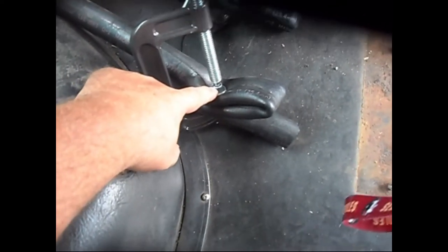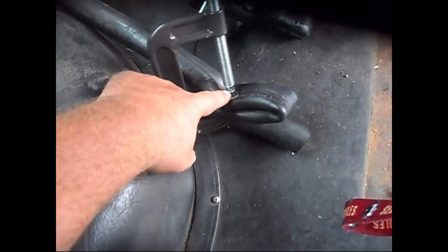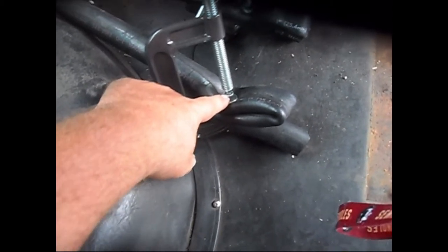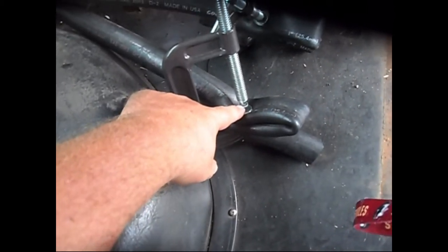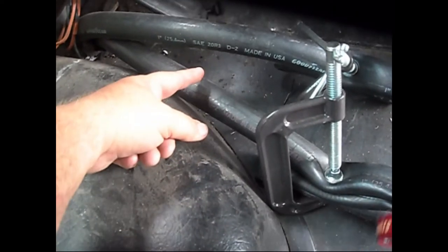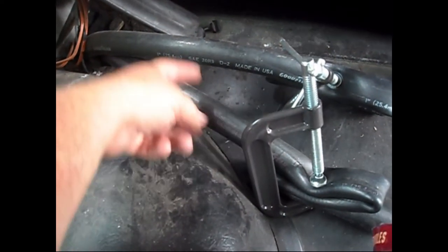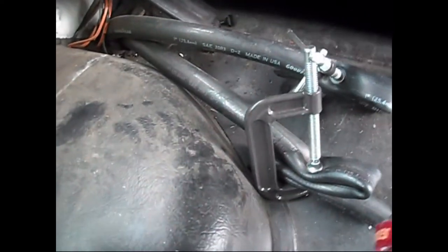What you don't want is, when you're in the mountains somewhere driving around, this ruptures inside right behind the driver. You do not need 200 degree antifreeze spraying all over the place. That's how people get killed. So I'm going to cut it off back here somewhere. Somewhere in here is why I left plenty. And then put those two together, an undamaged section.